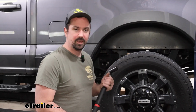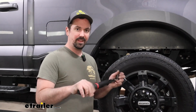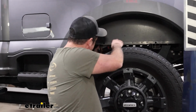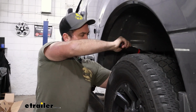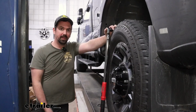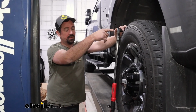This is going to be important because you're going to be towing a lot of weight with this, and you want to make sure that long term it's not going to become loose or over tightened. And this is a great way to make sure that that's going to be perfectly dialed in. So we'll go through and get all of our rail bolts properly torqued. Once you get all the rail bolts tightened down and torqued, make sure that you're getting those bolts that go into those blocks that we fed in as well.